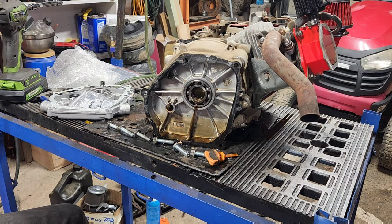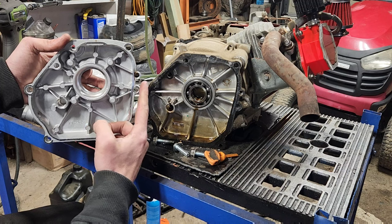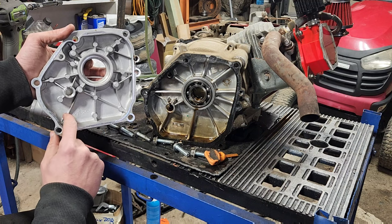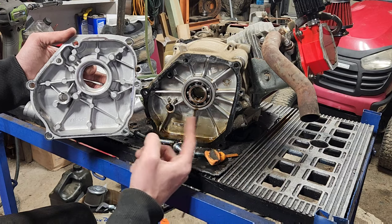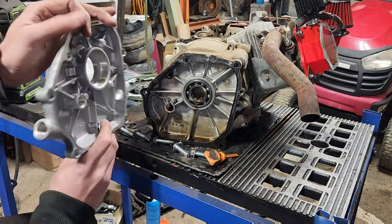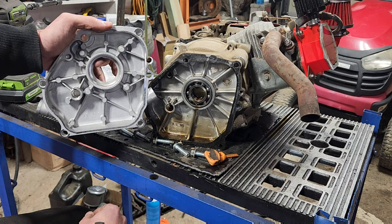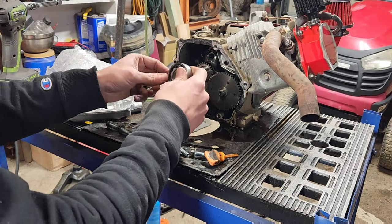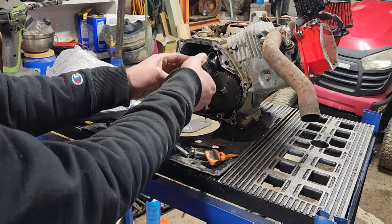There's the side cover for the generator. What we can see is we're missing a reinforcement there, and I don't know if that's critical. It's interesting — this one is way thinner, that one is way thinner, and a bunch of these features don't exist on the Predator case. I see — so that's the difference: the casting for those holes is why this has things that don't exist on this one. Let's see whether these actually fit. There is a lot of wear on that crank, but let's see if they actually fit. That's a good sign if we can manage to get them into that case piece.